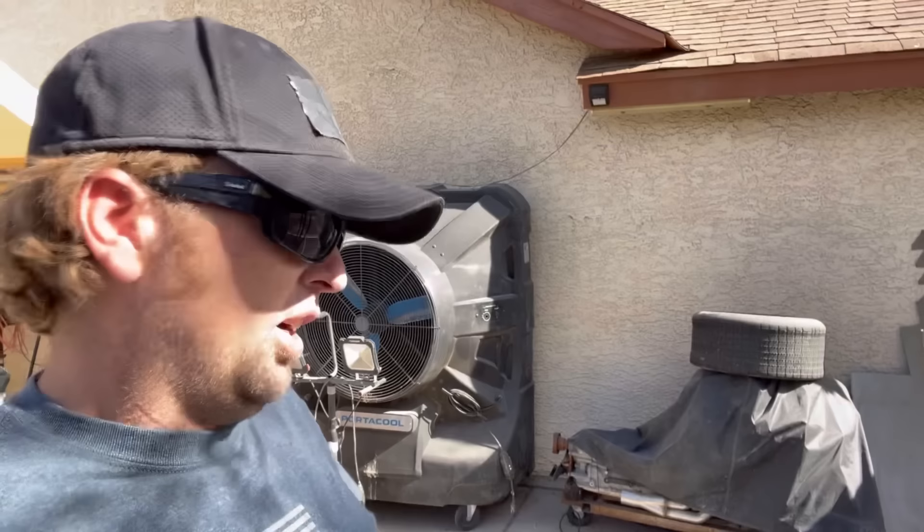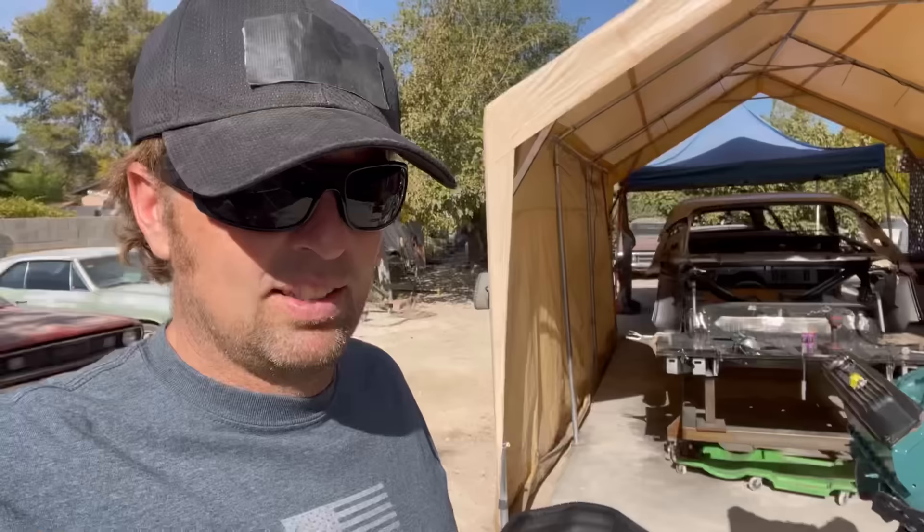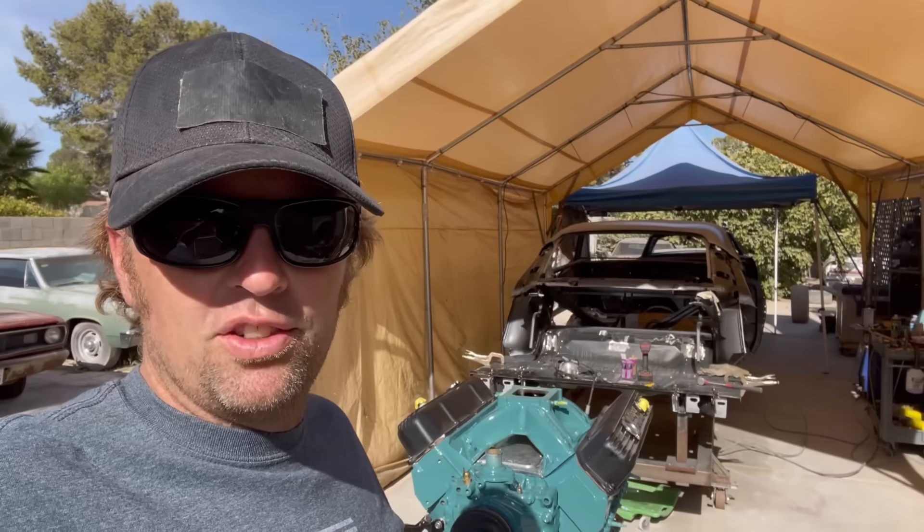Me and Tall John from Tall John's Fun Shop on YouTube — a very knowledgeable carburetor guy — we both do a lot of street tuning. Most guys buy a carburetor, pull it out of the box, adjust the idle screws, adjust the idle blade, then just do a wide open throttle plug pull for horsepower. But they totally forget about what they drive on 95-99% of the time, which is just the driving circuit. They never tune that, and then they wonder why they foul plugs all the time and it runs like ass on the street.